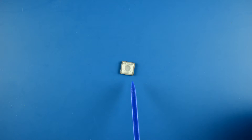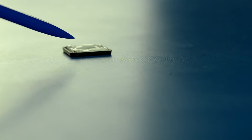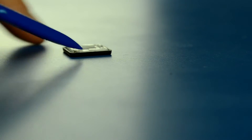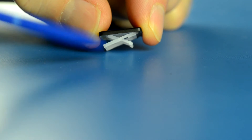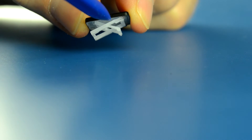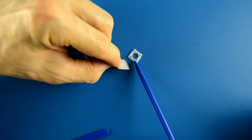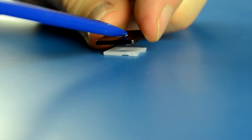This is an example of the majority of what the keys are on there, like this size right here. What you have underneath is this plastic scissor hinge that's attached to the key underneath. So what you're actually doing is you're separating this hinge from that key when you slide the tool underneath. You can kind of see how it drops right there. When you're separating the two, you're taking this tool and sticking it inside this little fold right here. And then when you press in, that snaps that right off. So that's why it's important to go in on the actual sides of it and to think that that fold will be somewhat centered in that key.